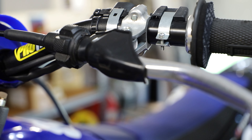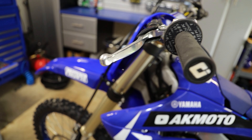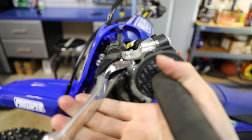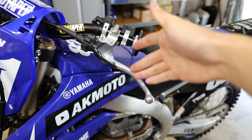And that's how you replace a dirt bike clutch lever. There we go guys — out with our old broken lever and in with our new lever, works very very nice and smoothly. Everything's adjusted with just a tiny bit of play, both our top bolt and bottom nut are nice and snug, and we have a little bit of fresh waterproof grease so it'll operate smoothly in the future. Hope you guys enjoyed this video — I tried to keep it really simple and easy. This was a YZ250F 2021 but it's going to be the same process on pretty much any dirt bike. Comment, like, subscribe for more videos, and I'll see you in the next one — peace!